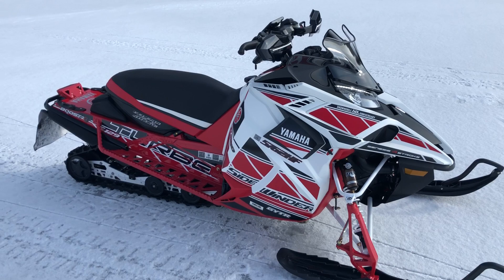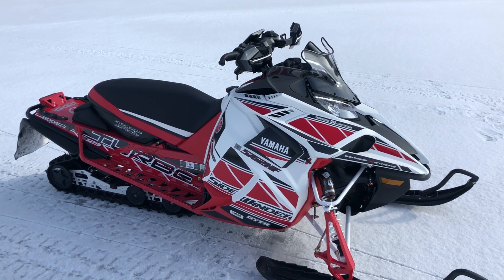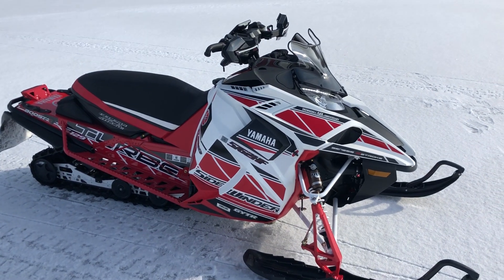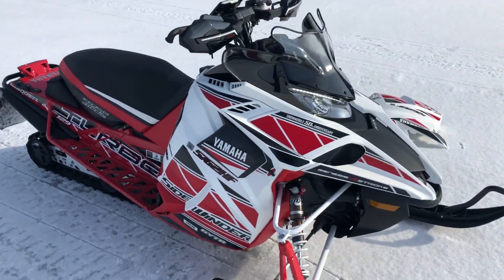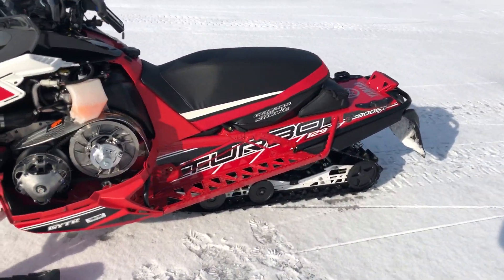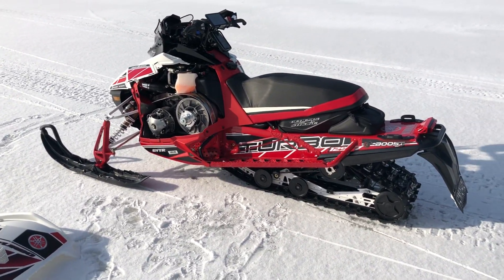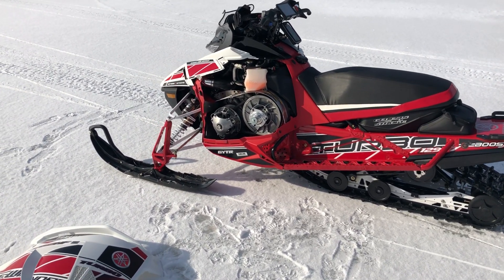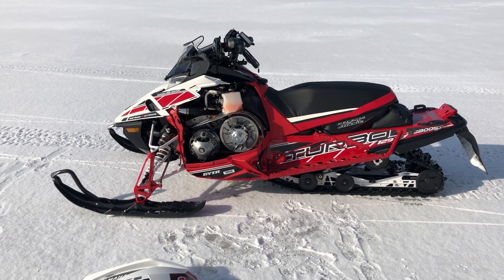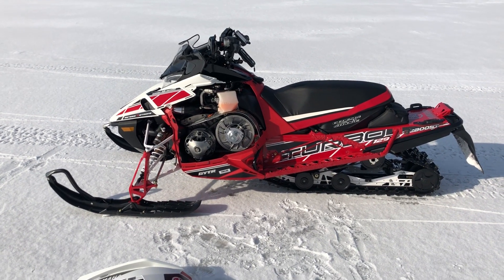A little bit of a first test on the Hurricane 240, 270, and also the 290 map — but I have not tried the 290 map and I think I'm going to hold off on that. I got a little quick knock light — knock protection on the 270 map — after about 2,200 feet. I got a little blip of the light, so I backed right out of it, because this gas has been in there for a few weeks and it's probably a little questionable. So I didn't want to hold that any longer.